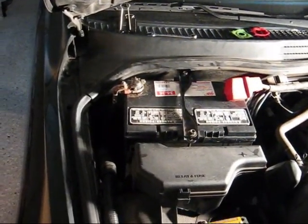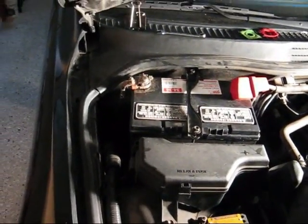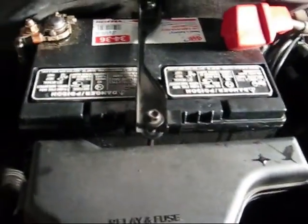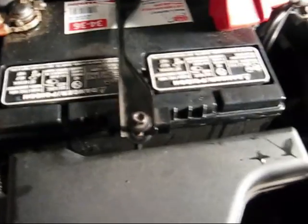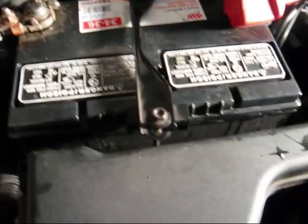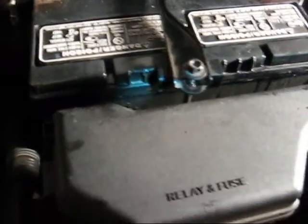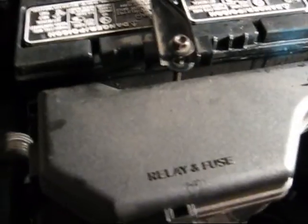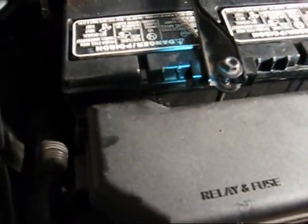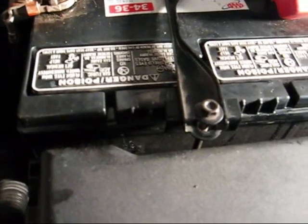I want to explain why I'm replacing the battery. The car still starts actually, but what I noticed — this is a new car to the family of Froggy — I did a battery service the other day where I topped up the distilled water. I noticed there was some little sweating, little leakage of battery acid around the edges. I didn't think too much about it. I filled it up, ran the car a few days, and then I noticed there was some drippage underneath the car and it was battery acid.